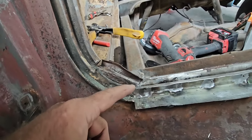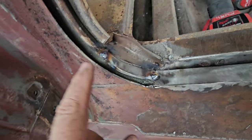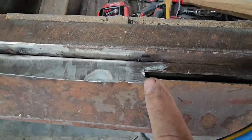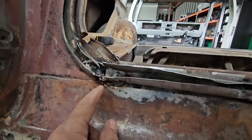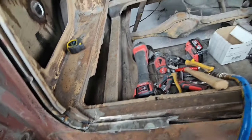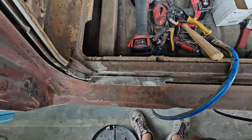I'll do the same with this and then add this last section in here. Kind of blew through the old metal but fixed it up - it's not the neatest but tack welded there, one more in that, cleaned all this up, another weld under here. Knocked that booger weld off, tacked that back up. Knock this one back over, seam seal it after I wire wheel the whole lot in this end, then seam seal it - pretty much done for that section.